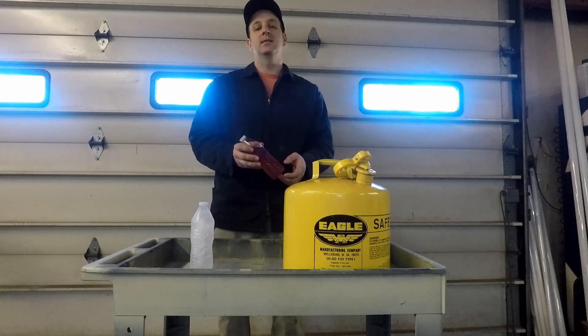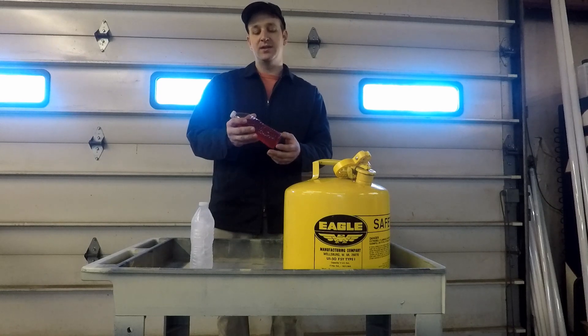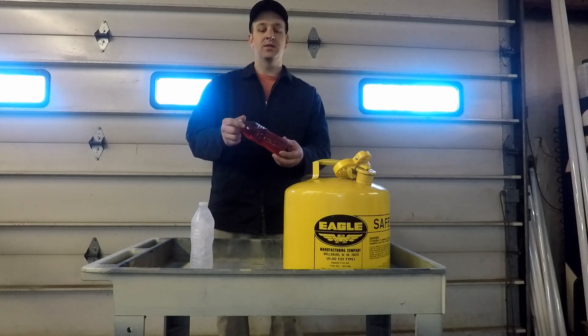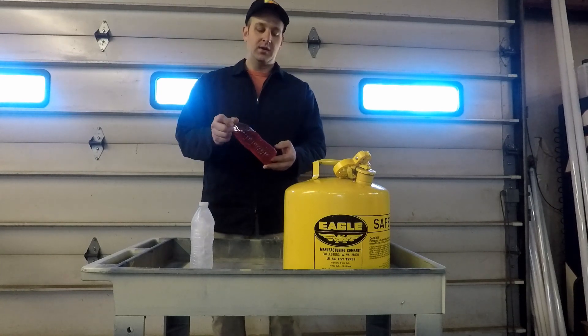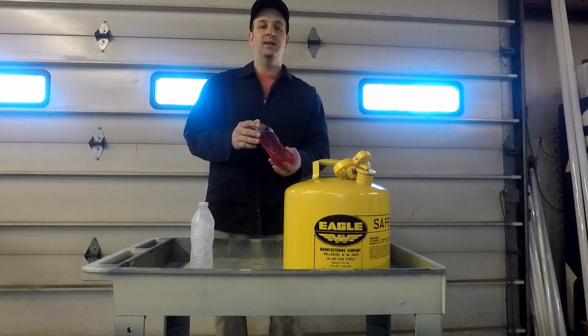This is a specific test. The temperature got down to 2 degrees Fahrenheit last night. This fuel did not gel. You can see just the very early stages of it starting to gel. So I think that the oil company has to treat this fuel year-round with some sort of anti-gel.